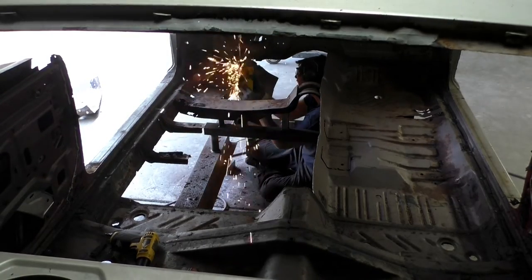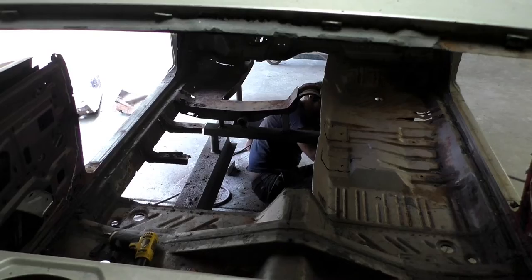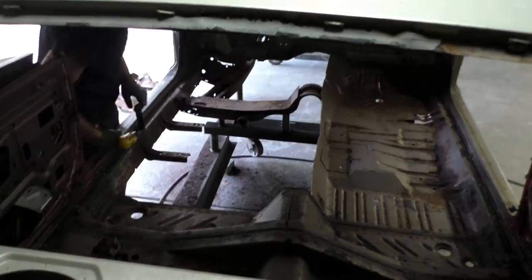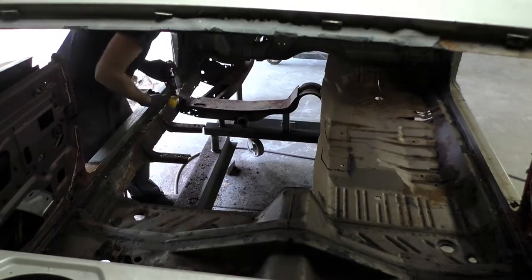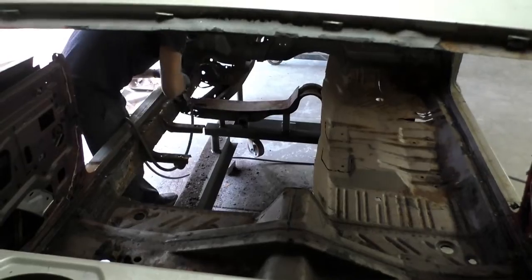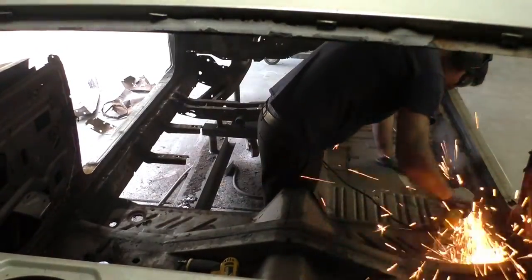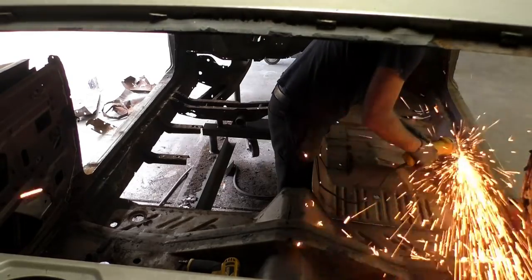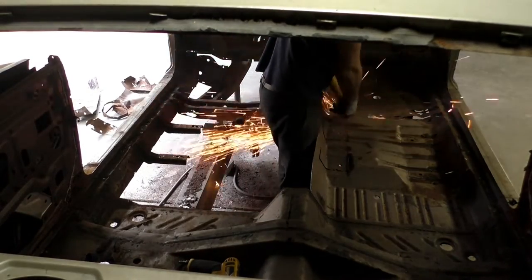Moving on to the front of the car, I'm tracing the bottom of the frame rail to make sure I don't cut it. It's kind of hard to identify from the top where it goes versus the side and back area, so it's easier to climb under the jig and use the cutoff wheel and make reference marks. The camera's a little shaky — it was sitting on the car while I'm air hammering, so just bear with me. With the air hammer I'm basically working my way up the spot welds and just ripping right through them. There are going to be spot welds still left in most areas, so you'll have to go through with a grinding stone or belt sand to clean them up. Making rough cuts first makes hammering up the spot welds a whole lot easier because you can tackle them from different angles.